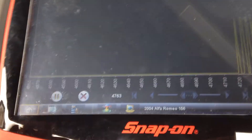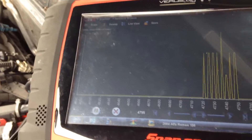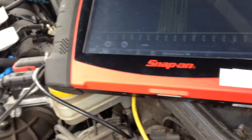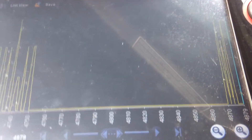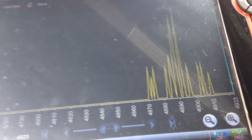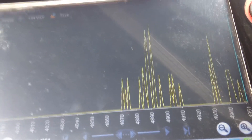Another thing we can do is simulate the output of the sensor by disconnecting it from the loom. We now have a fault in the system for open circuit, but I have connected my test light to the positive side of the battery — this is only an LED so we will expect to see very small current flow. I will just pulse the test light as you can see I am doing here, pulsing the test light off the probe. We can see we actually see a wheel speed signal here on live data as I pulse it.